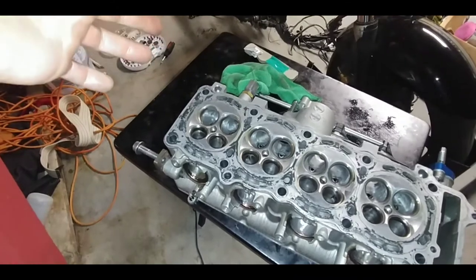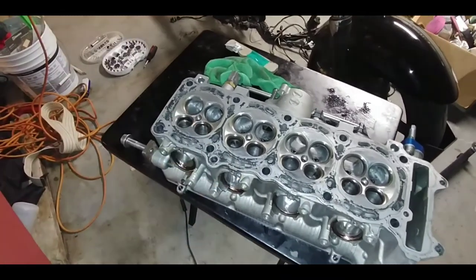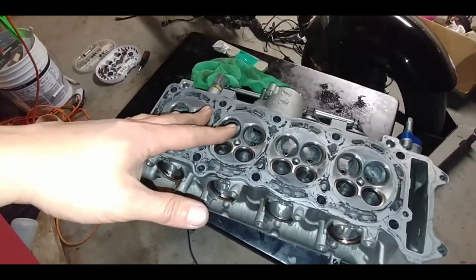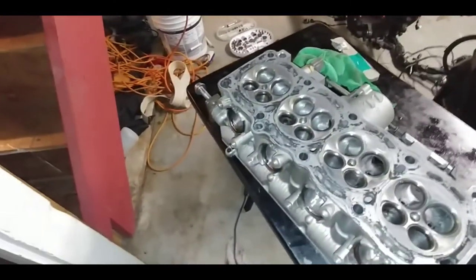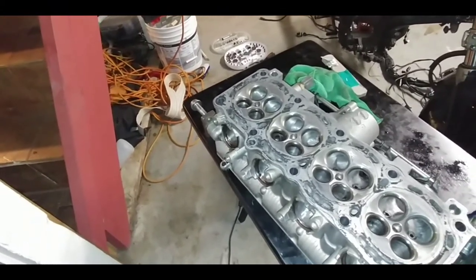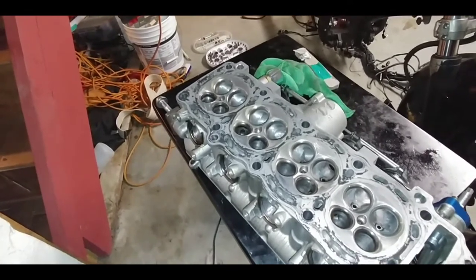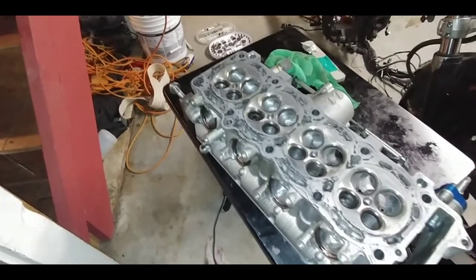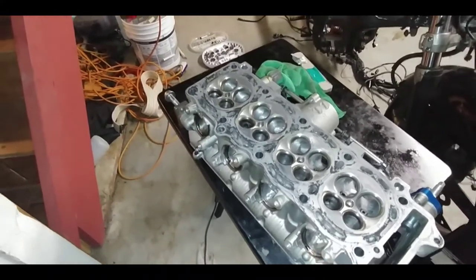I still need to clean the pistons, which I'll have another video on. Once the pistons are clean and the deck is clean, and the valves and everything are lapped and in, the cylinder head will be ready to go on. Then it'll just be a matter of waiting for the cams to come in, checking the valve shims, checking valve clearance to make sure it's not going to smack the pistons, and then going over to my buddy's house to degree the cams. Once that's done, it's ready to throw back in the bike and fire up.